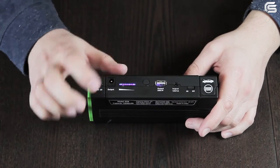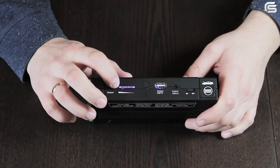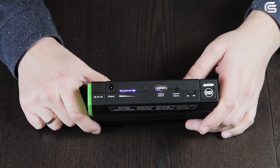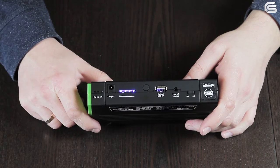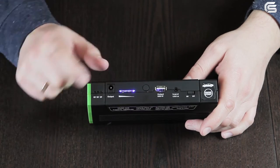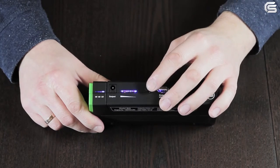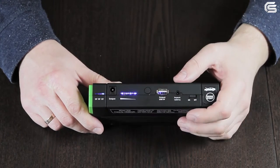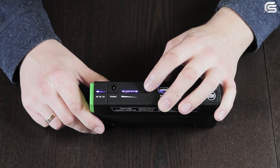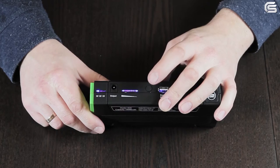The temperature here is nearly 40 degrees higher than outside, so the indicator shows a full charge. There is also an output for charging a laptop or a network device, with an output voltage indicator right next to it. This output is activated by a single press of the multi-functional button, switching between 12 volts, 16 volts, and 19 volts with each press.